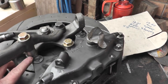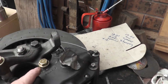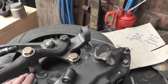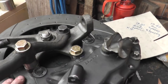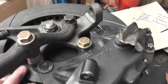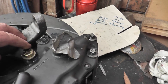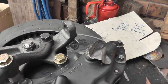I had to put the original Jag caliper mounts between the steering arm and the upright, and it bolts onto the top. What's happened is I've drilled through the thread on the Jag upright with a slightly larger bolt — I think it's a half-inch UNF type bolt — and a thread has been cut into this 5/8 plate which sits just inside the rotor. Everything screws into that: the steering arm and the other bolt.